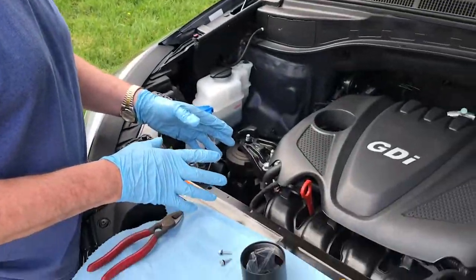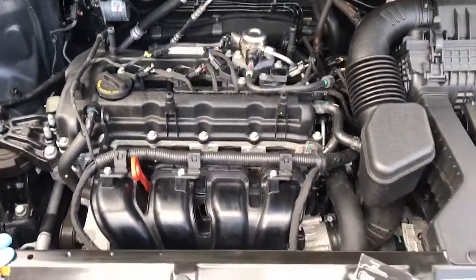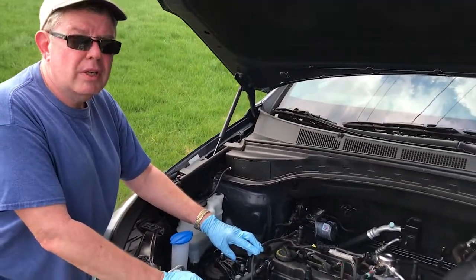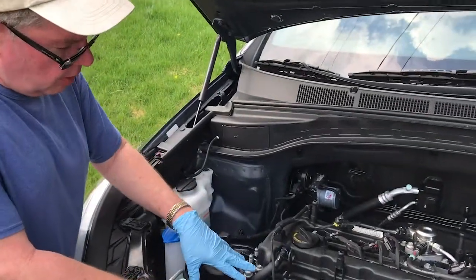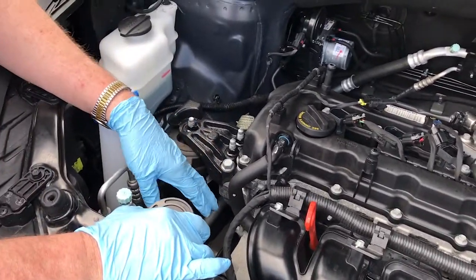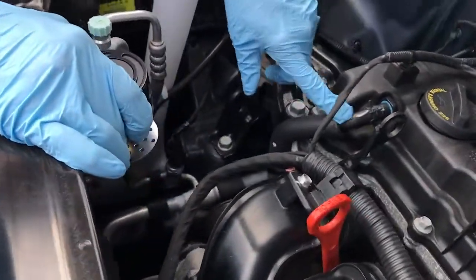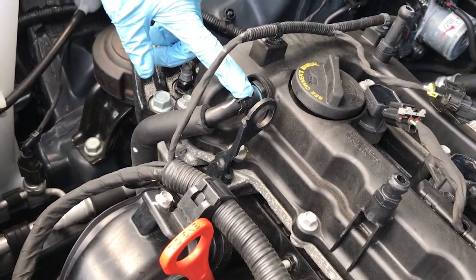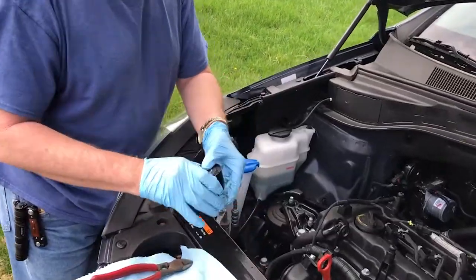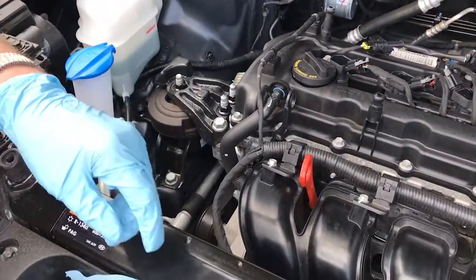In terms of the placement of the part itself, let me remove the engine cover. You'll notice that in this particular engine, which is the 2016 Hyundai Santa Fe 2.4-liter GDI engine, there are some limitations in terms of clearances. Typically where we'd like to install this is somewhere we have enough clearance. For this application it has to be right here, because it's near the positive crankcase ventilation valve, which is located right here. The way oil catch cans are typically set up is that you want to feed the outlet into the oil catch can so that it does catch the oil, and then the outlet goes right back into where you had disconnected.